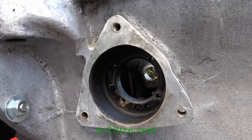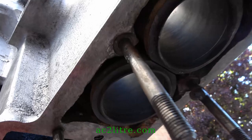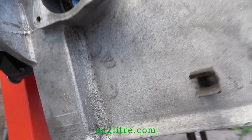Two of them used electric heaters to gently heat and expand the alloy block, resulting in liners falling out. Another one made an extractor and had no major problems. The fourth one used a club hammer, which did the trick. I did hear of someone suing a company in the 1990s after they smashed the cylinders attempting their removal.